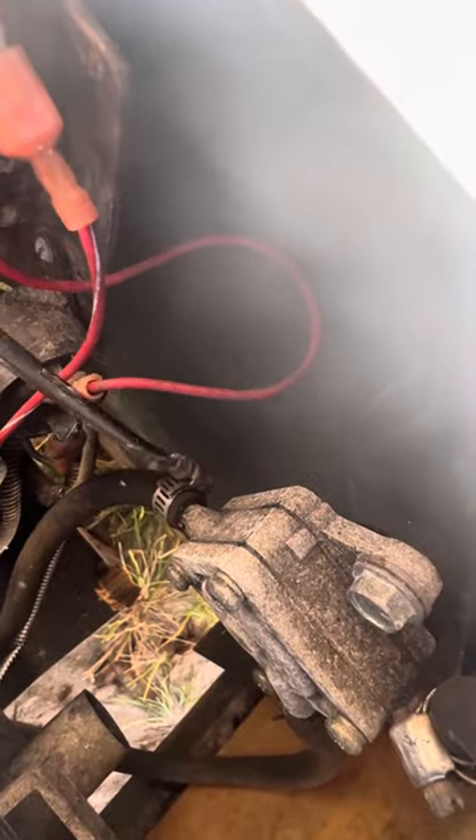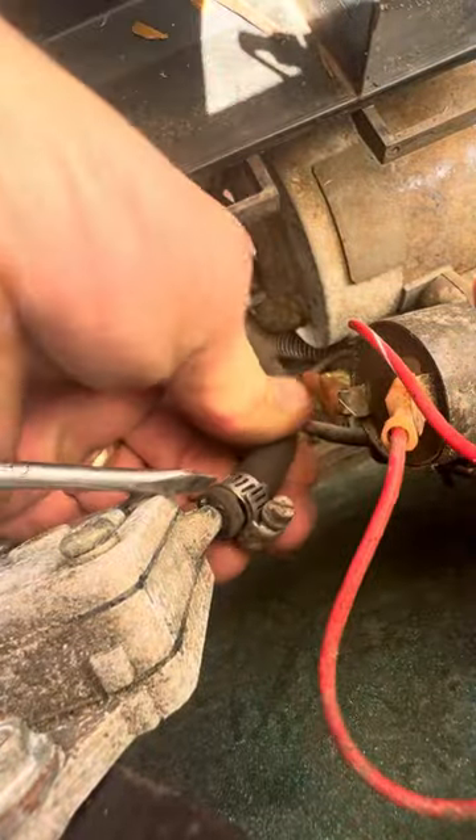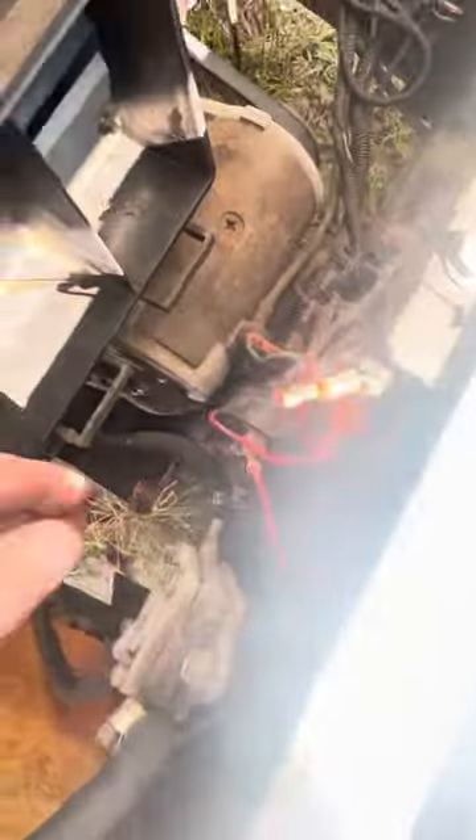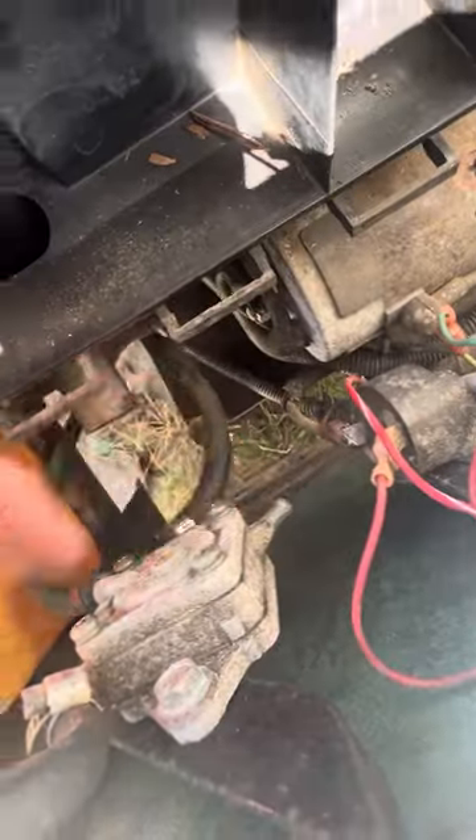What I'm going to do is take this off with a flat screwdriver. Be careful if you've got a plastic fuel pump, because they'll break easier. Got that off. Now you want to hit the gas and fuel should pump out of there. You can see the engine spinning over — you want to see fuel hit out of that fuel pump.